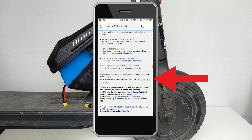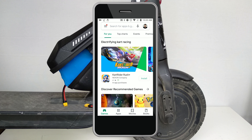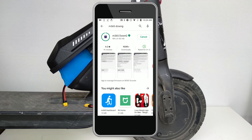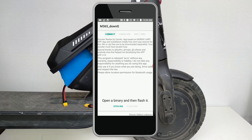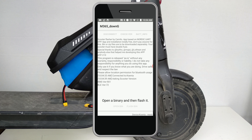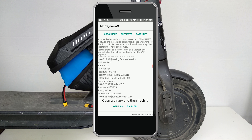Click on the patch button to download the generated firmware to your phone. Next you need to flash it on your scooter. Launch Google Play and install the M365 downgrade application. Open the app, connect to your scooter, press the check version button, select the downloaded firmware file, and click flash.